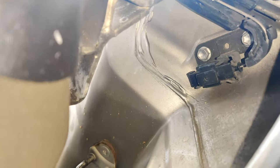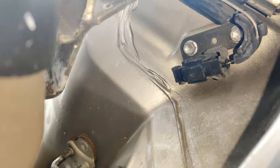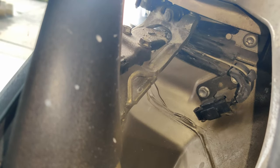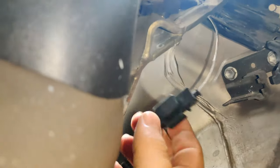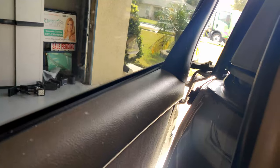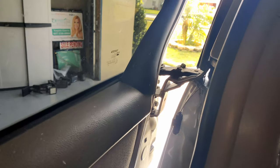Since the cable snapped on its own, the other end of the cable — let's see if I can focus on that — it's actually right there. That's where it connects to. We can actually pop that off and see what that does, and see if it makes it easier to remove or cut the cable. With this tool, I'm going to go ahead and pop up on that. I went ahead and popped it off — see right here. Now let's see what that does to the sliding door. And there we go — we've got the sliding door moving back and forth easily.